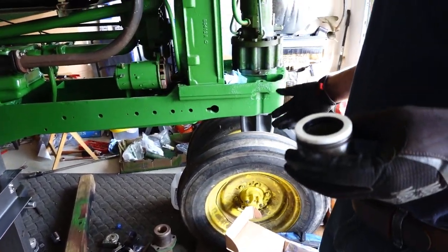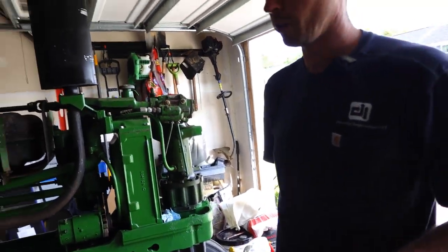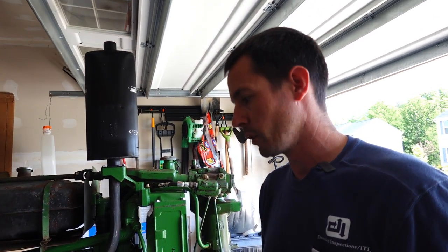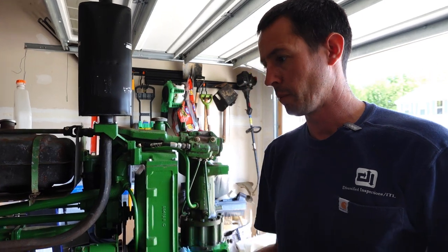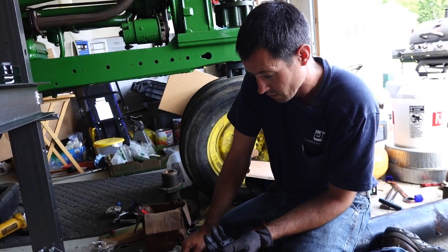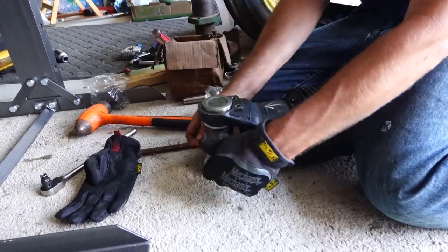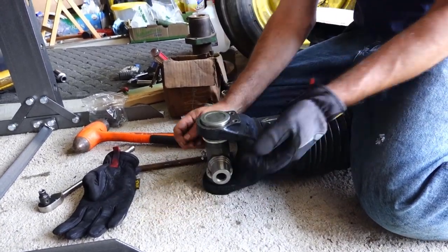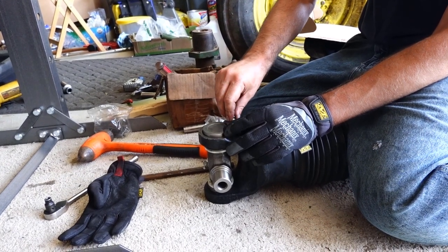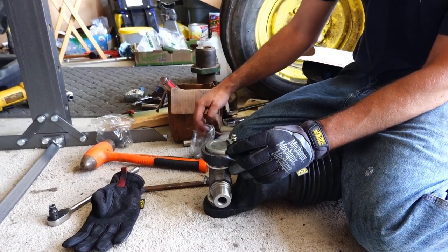And this is basically, any type of PTO shaft or even a U-joint on a car, pretty well the same process for the most part, other than the hardware that might be used to retain them. Pressing them out and pressing them back in is basically the same process. So we got the opposing cap put in, everything smooth and free turning, should be a little tight, not super tight. And then we're just going to put these retainers on. There are our torque specs for these, but once we get it in the truck, we'll torque everything.